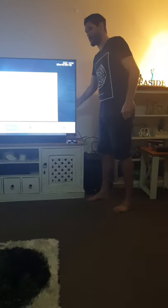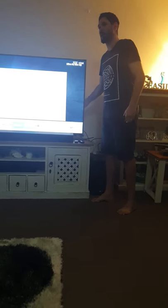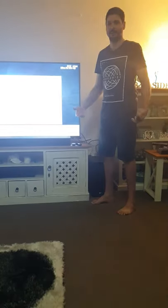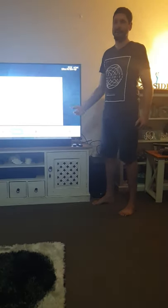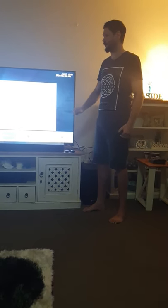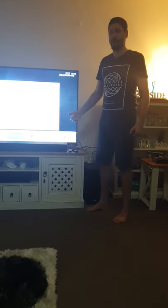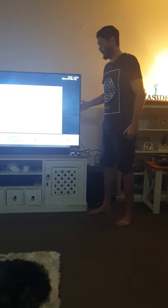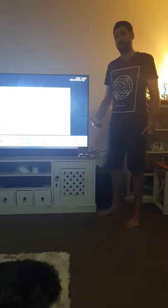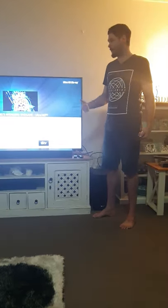Last recap: HDMI up to the soundbar, HDMI down to the DVD player. The HDMI in the back of the TV you don't really need — only for HDMI if you're watching Netflix to put it through that way. It's not running through the TV, it's running through the soundbar. You might actually only need the ARC from the TV to the soundbar and the HDMI from the soundbar to the DVD player — that'll probably work too. Give it a go; we're all in isolation here. Hope everyone's safe, good luck!